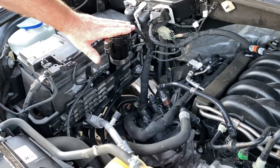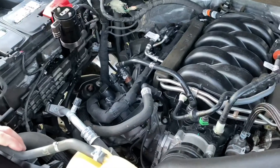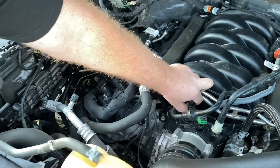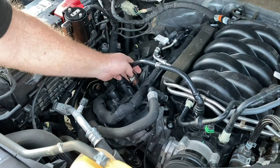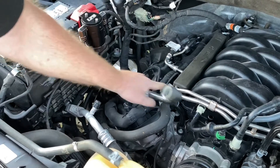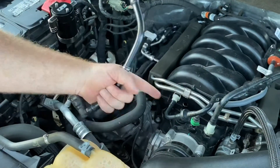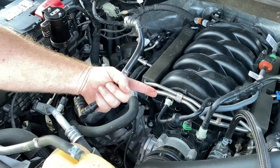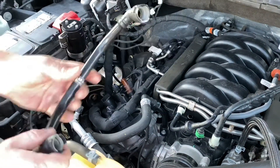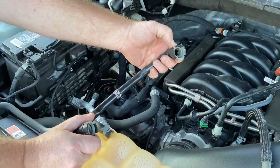Once that's mounted, you need to remove your PCV hose. This goes to your intake manifold, and this is the problem on these trucks — the oil from the PCV gets carried through the hose and into the intake manifold. The catch can is going to catch that oil and keep it from getting into the intake and coking on the valves. Remove these really easily; the fittings just pull to the side and down on both ends and pull the hose out.